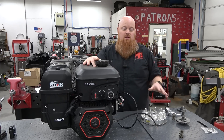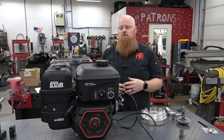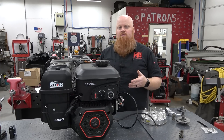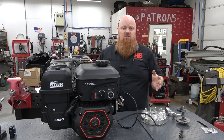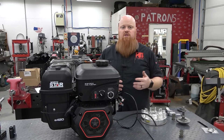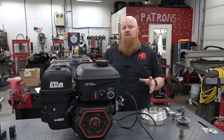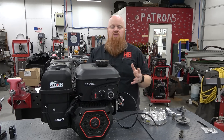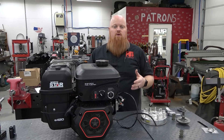But to do that we have to have a standalone ECU, because this is like old-school EFI that you'd find in early 90s and late 80s vehicles. It can't really adjust itself. Like if we put a better flowing air filter and a better flowing exhaust, it's not going to compensate for those things. It has just predetermined numbers set in the ECU. It doesn't have an oxygen sensor or a mass airflow sensor, so it can't tune itself and know how much more air is coming in. So we're going to solve that by partnering with Micro Squirt — they're going to hook us up with a standalone ECU and help us tune this thing out and put more sensors on it to make it a truly real performer of a fuel injection engine.